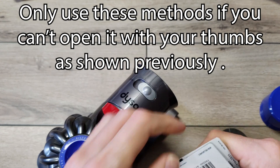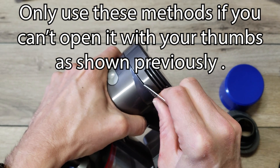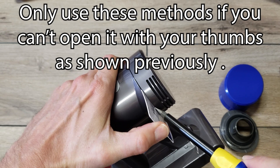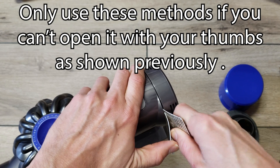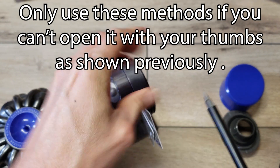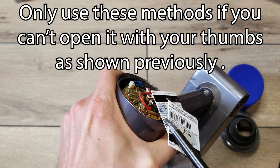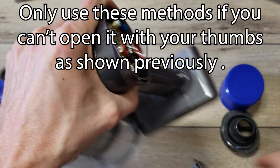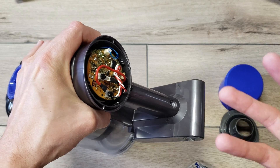You can twist a little bit — there you go. So if you fit a thin card in this space here, it's going to protect the plastic on this side, and then you can use a screwdriver to get in. Once you squeeze another card in and create a gap, get a smaller screwdriver underneath and pop it open like that. No damage has been done to this plastic edge because it was protected by the cards, and it didn't do too much damage to the other side either — just a little nick.